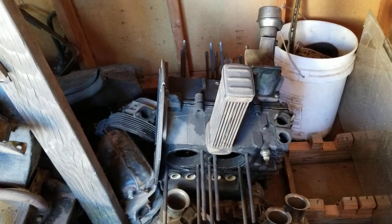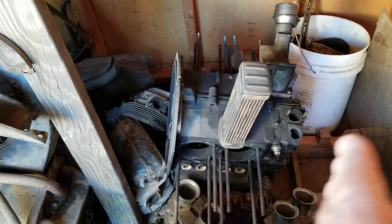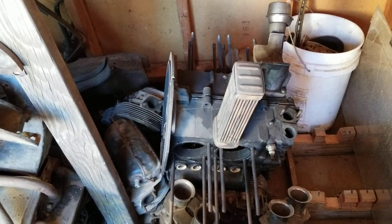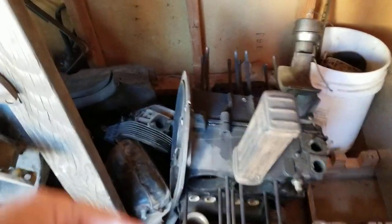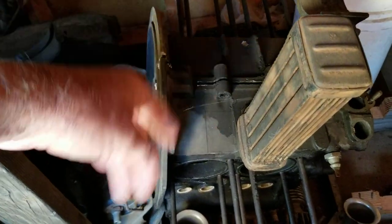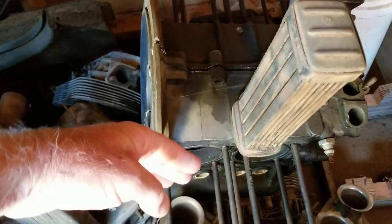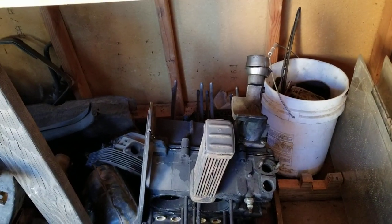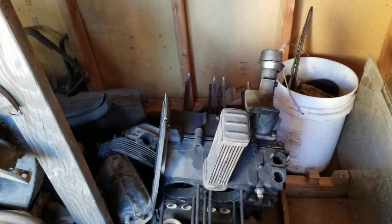So I kind of have a cutting point. It's 78: larger than 78, I like to see aluminum case. Smaller than 78, you can actually do a regular mag case and be okay. Because of the more reciprocating motion here, because now you have larger pistons and you have more distance moving up and down, it puts more stress on this case. So this is what you're thinking about. You kind of have to be your own engineer when you start going larger on the engine. So that's one of the things I like to see.